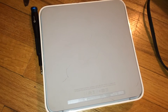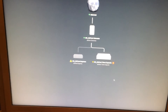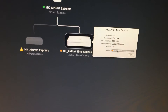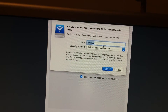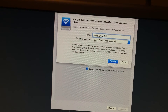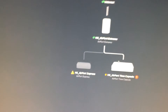Once your pad is back on, we can now hook everything back up and then go to our Mac and open Airport Utility. Once you plug in your Time Capsule you will notice that the orange light will continue to blink. From Airport Utility you will be able to click here where you will see a notification saying the internal disk needs repair. We can go to Edit and from here click Erase Disk. We will name it whatever we want — in this case I'll be naming it Jasen Gregg Hard Drive because Jasen Gregg is what my network is called. We click Erase, it will ask if you want to continue because it can't be undone, we click Continue, and it starts the process.